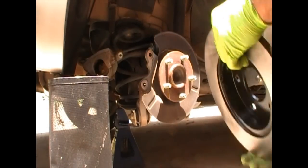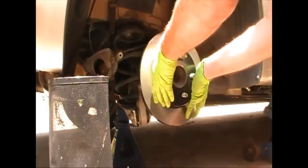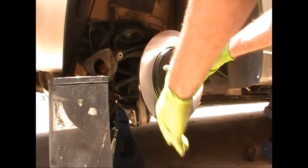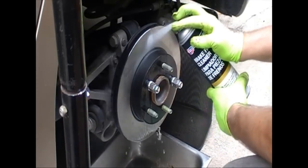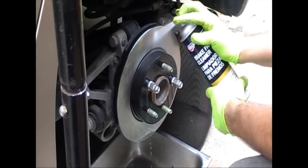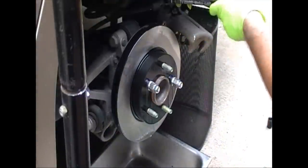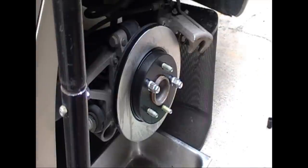You're going to need to pry the edge out and kind of tear them off. I don't put them back on when I reassemble it — just put the new rotor in like that. When they send you these rotors they're packed in grease to keep them from rusting, so you need to clean them. I already cleaned the inside before, and you'll do this again when you're all done — give it a good squirt just before you put your wheel and tire back on.